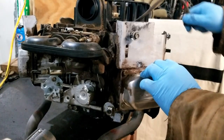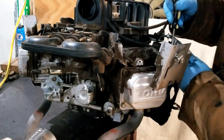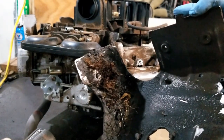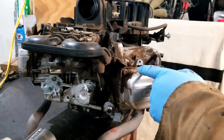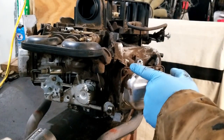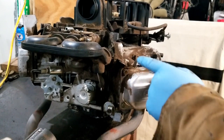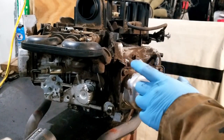Nothing can be standard even in recent years — there's a tiny 5/16 bolt right there. Spark plug wire off. Inside there's a little vacuum tube, just plastic, so don't break it. Look at the crap built up in there. Just for reference: clean engines run better than dirty engines. Dirty engines have a tendency to overheat because they can't cool efficiently — all this dirt, oil, and debris holds heat onto the engine.